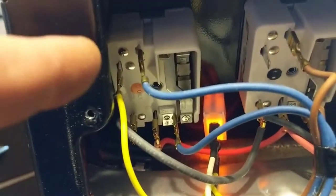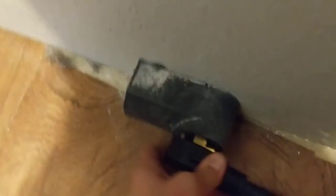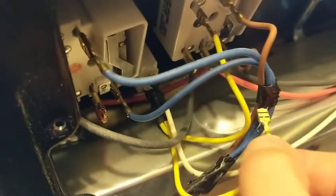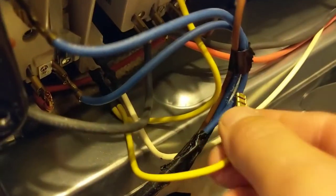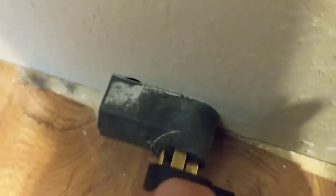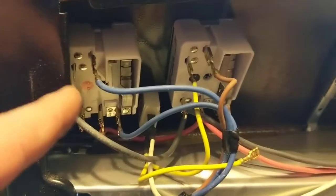As you can see it's still glowing, so it's gonna be that one there. We'll plug the first switch back in and tuck the second wire in between here so it doesn't touch anything. We unplugged it from the second switch — and the light is out. So that's our bad switch right there.